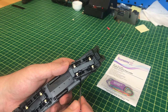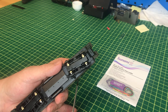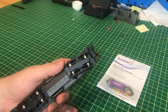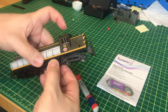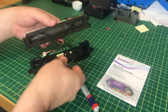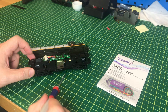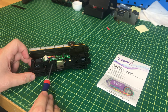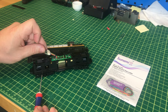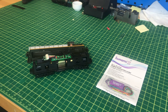You're going to see two screws right there. This particular model only had one in there, so be sure to check and document that. Once you remove those — I've already removed them — the body shell simply lifts off and out of the way. With this installation, we're going to notice there is a small PCB board mounted right here on top of the motor, held in place with a couple of screws.